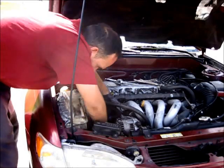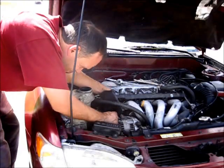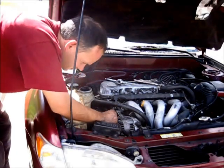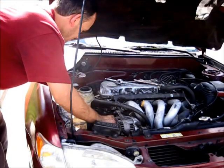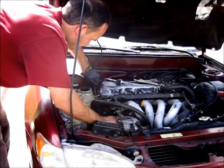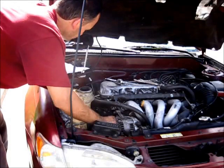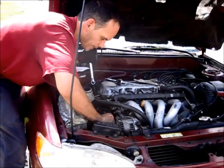How long has this taken so far? I'm going to put it around the front part. We're walking it into the right position on all the pulleys. So now all we have to do is use our other wrench — put our 19mm back onto the belt tensioner pulley, take our 17mm and put it back, making our torque bar, and we pray.